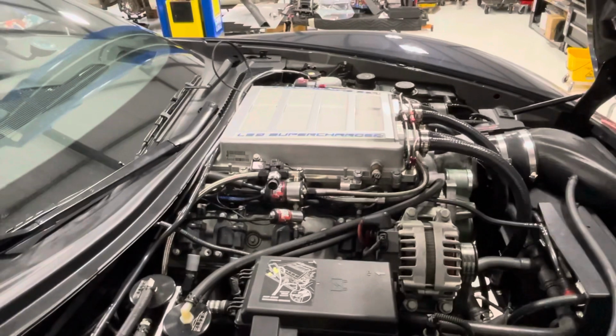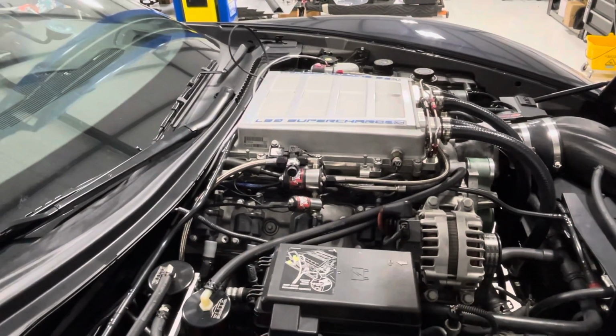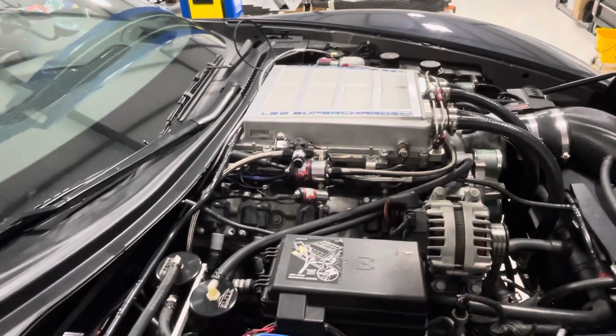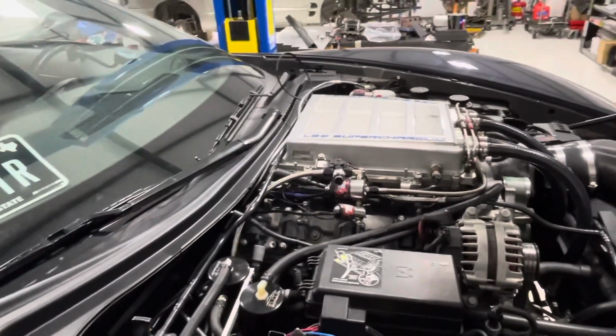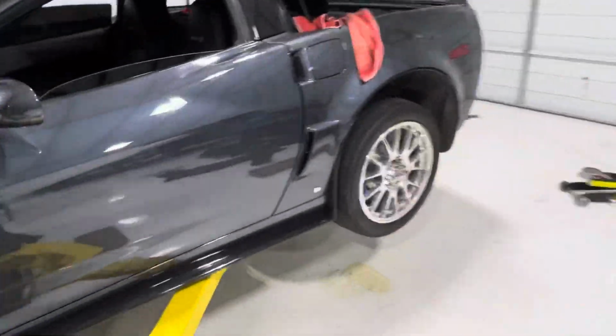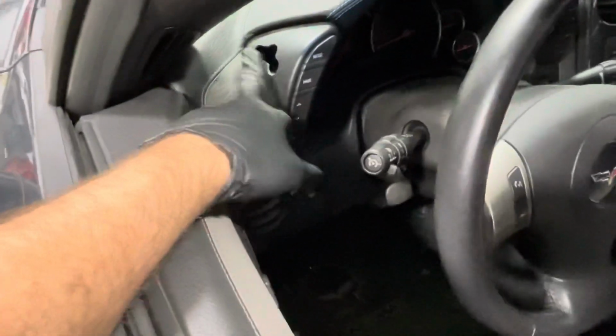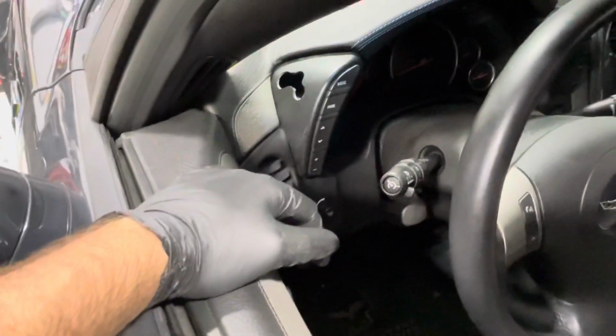Once I got everything put together, I went to key on power to make sure everything had power, and I had no power anywhere. Everything was dead. As it turns out, electronics are very picky when they don't have ground. I used to have an Innovate wideband in here, right up where this Mickey Mouse looking hole is now. They don't make these anymore.